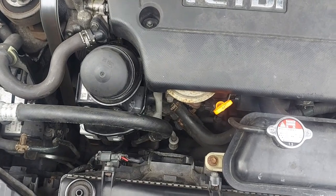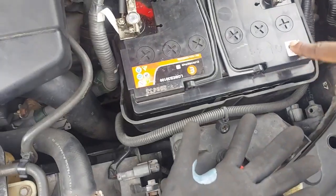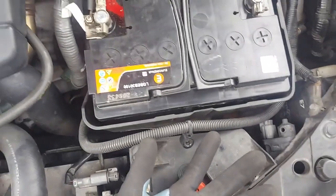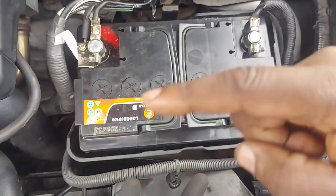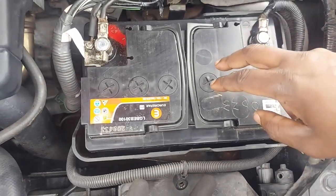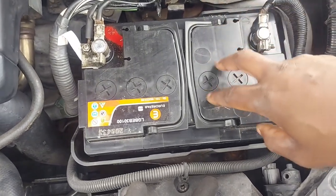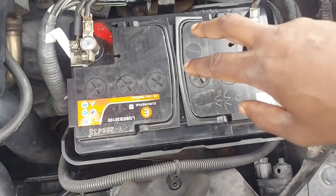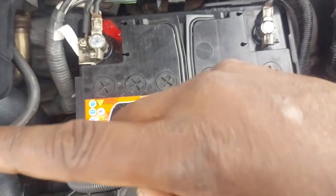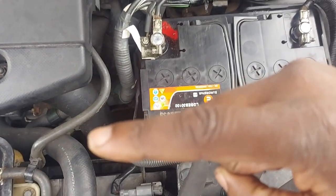Alternator is working fine. Here's the other thing that I didn't say to you. I bought a new battery for one reason. Usually when you see an alternator do what it was doing, you may find that the battery has developed high resistance. When the battery develops a high resistance, gentlemen, you are not going to see that with a multimeter. You are going to see that with an oscilloscope. If it develops high resistance, it causes the alternator to work harder, and as the alternator is working harder, the diode starts to overheat. Now you have a problem.